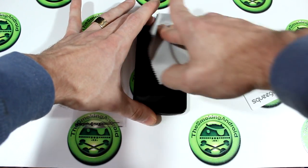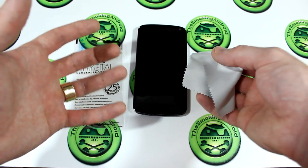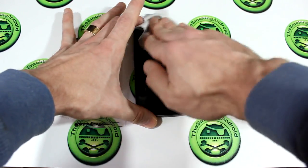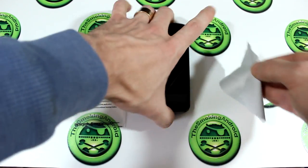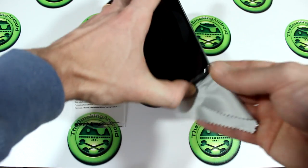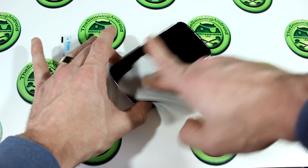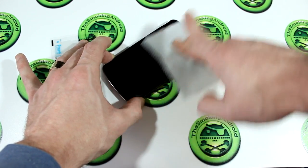The reason behind that is because when your device is warm, it warms up the display, and if the display is warm when you're applying a screen protector, it actually encourages air bubble pockets — and that's always a pain to get out. Furthermore, if you wanted to, you could also toss the phone in the freezer for about 60 seconds, and that should cool it down enough to successfully apply the screen protector while minimizing bubbles. Also, you're going to want to wash your hands — make sure no oils are on your hands because that will get trapped underneath the screen protector and also encourage bubbles. Getting an alcohol wipe is the best way to clean the display, so you can remove any grease over the oleophobic coating. That oil also encourages bubbles.